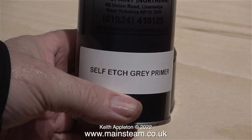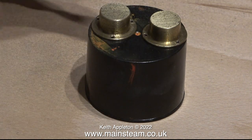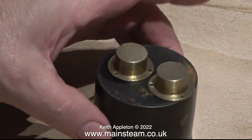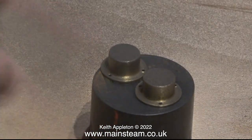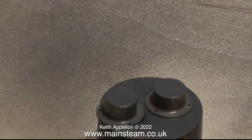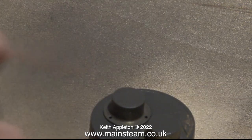These images are a bit grainy because I filmed it last night and it was quite dark. Here is a can of self-etched grey primer that I'm going to spray on the hubcaps first. I placed the hubcaps on top of an aerosol cap and gave them a light coating of the etching primer. Before anyone writes in — yes, I am aware that this etching primer is not designed for brass, but it doesn't know that, so it sticks really well. I gave the hubcaps a few light coats and then left them for a few hours for the etching primer to dry.